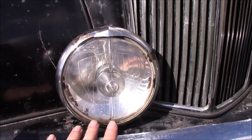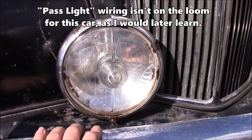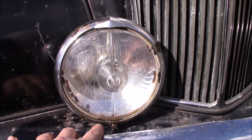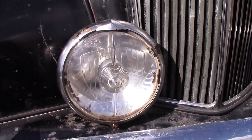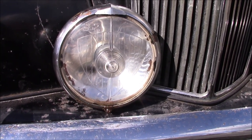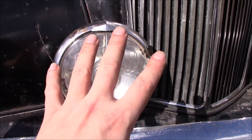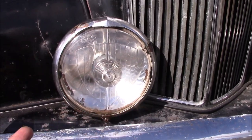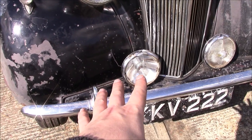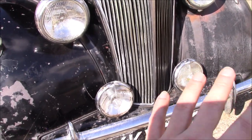On the original loom there's one wire for the pass light, which appears in the brochure but also appears blanked out in the brochure — I recently got hold of an original brochure for one of these cars. I wonder if it's a carryover from the Briggs-bodied cars that they then blanked off on these. That's wired as per the wiring diagram I have, so that should work. The fog light isn't wired in yet — I've not got that far.